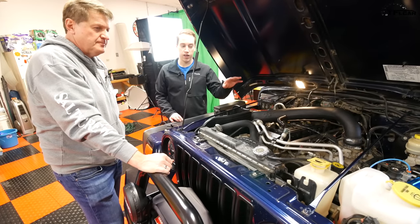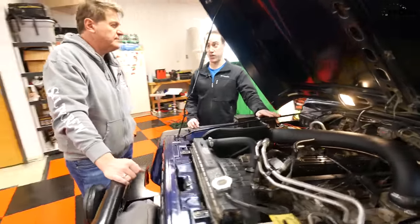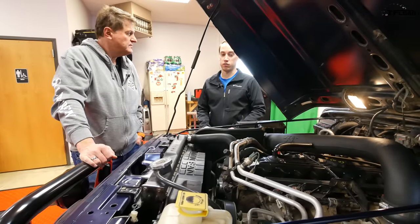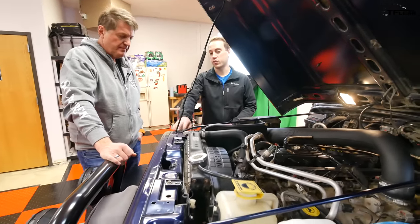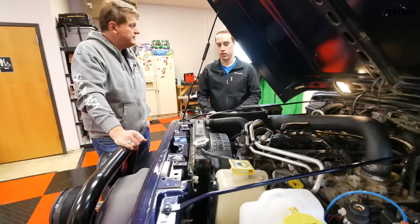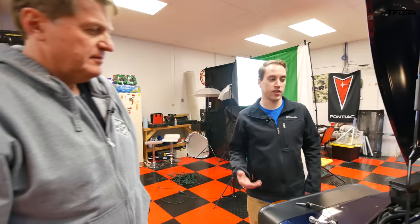It's a very extensive process. If you did it at a dealership it would cost a lot of money, but Karsten did it himself. It cost him about a thousand bucks to rebuild almost the entire engine — just new gaskets, no boring — and took about a week. The whole front end comes off so you can access everything easily; it takes only about 30 minutes to remove. The engine has 115,000 miles and was beautiful inside — just the camshaft gear was screwed up. He also had a rear main seal drip, which he replaced while he was in there.